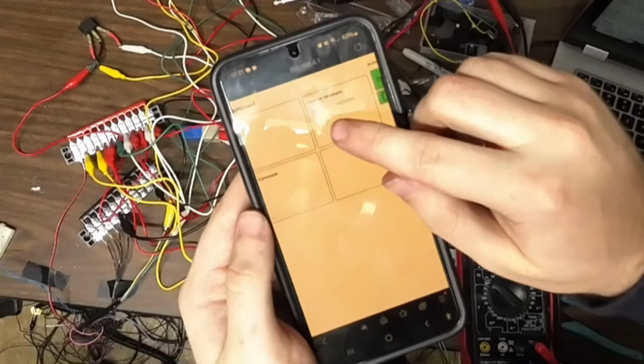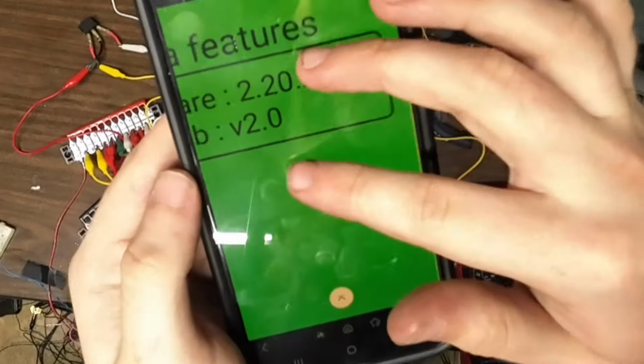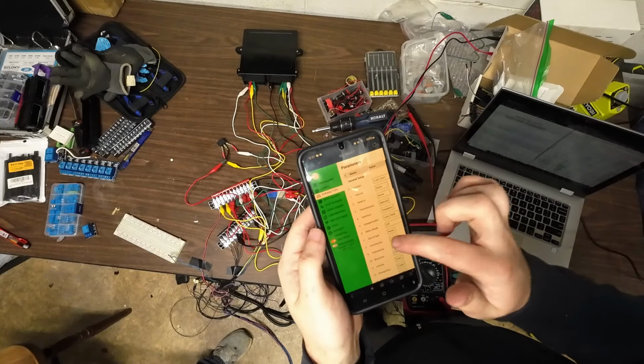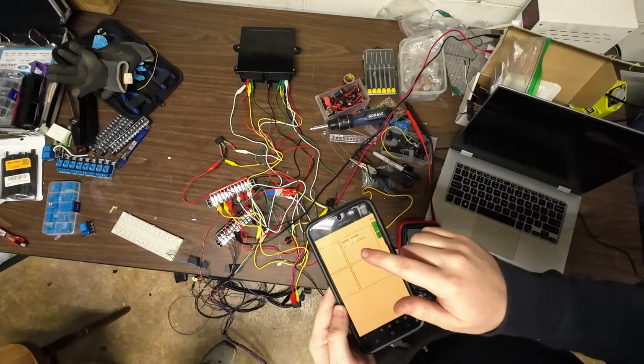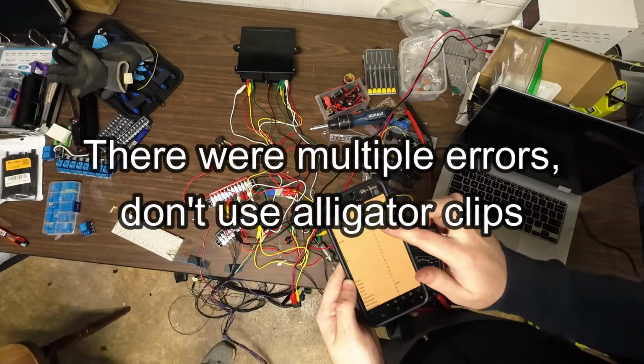Look at that. I got an error. Number 6, stop for pre-charge. Yep, and you can see right there, 2.20.a. So good. We have updated successfully, and it knows that there is, in fact, an issue. So let's go to parameters. Oh, it kept it, actually. We got a stop code called pre-charge. That's still there. Here, let me go to spot values. Oh, yeah, it's pre-charge fail.